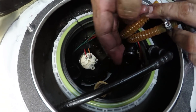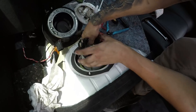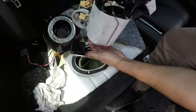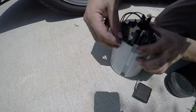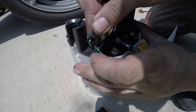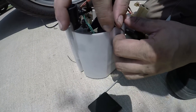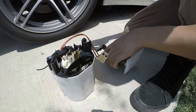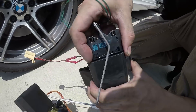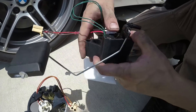All lines are disconnected, so the bucket is free to be pulled up and out of the tank. We're going to retain the factory float along with the wiring, so we'll unfish it from the three little hooks that hold it together, then remove the float by pushing it forward and pulling it straight out. Now we can transfer this to our Spool Performance Stage 2 setup by sliding the back in just like that.